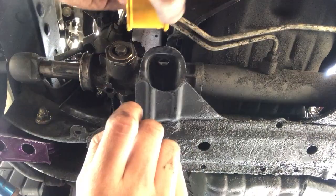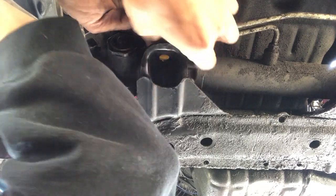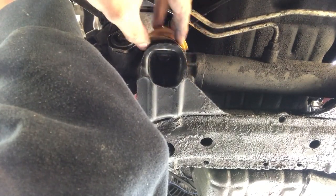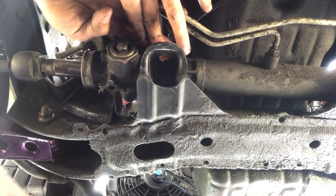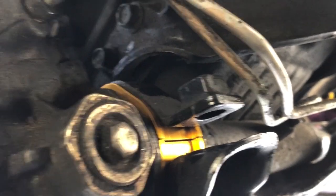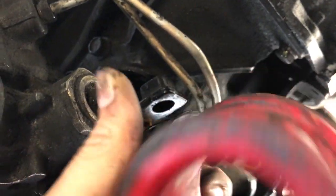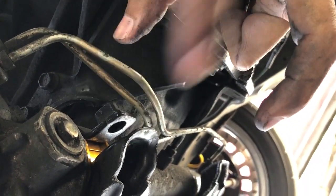So the PBM bushing comes into like a triangle, like a teardrop shape. That is what it's looking like right now, and literally just bolting this on was probably ten times faster than it was to get the old ones on — it was such a pain in the ass. So far I recommend the hell out of these. Note to self: when you install these, there's gonna be an open side, like a C-shape — make sure that C-shape is facing the front of the car.